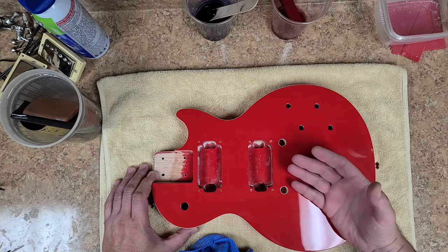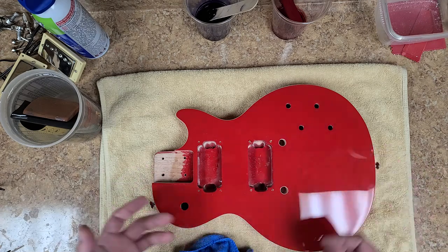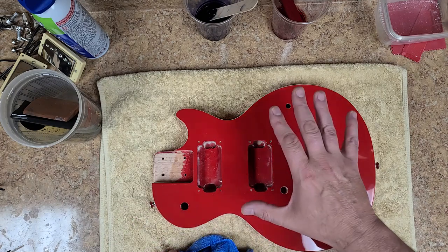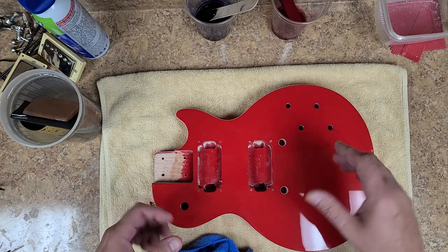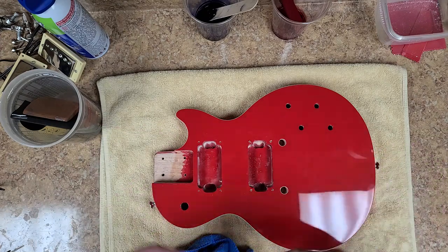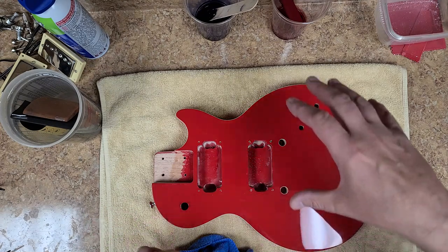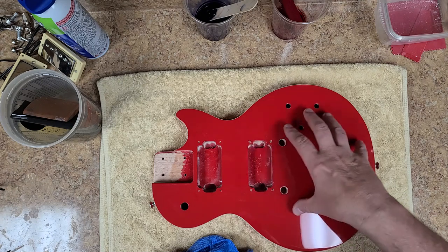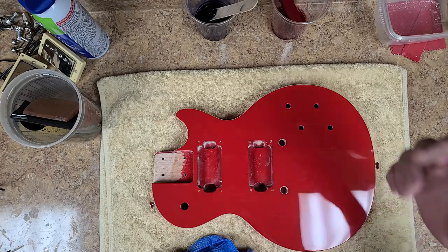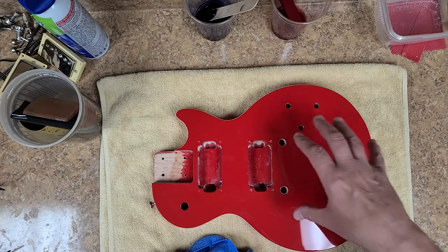If you use anything lighter than an 800 grit sandpaper, say you're trying to mask something off or your design needs to be taped, and you've already got part of the design laid out on your finish, and you have to mask over it so you don't get bleed through or paint on top of the paint that you just sprayed a different color. If you go to peel off that tape with 800 grit sandpaper, chances are your paint will stay on your body or whatever you're painting. If you use anything lighter than an 800 grit, chances are you peel that tape, you're also going to peel off bits and pieces of the paint that didn't quite stick into the finish that you sanded.